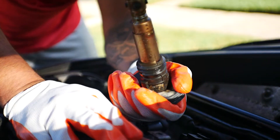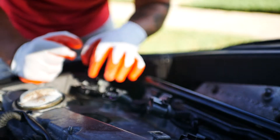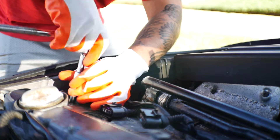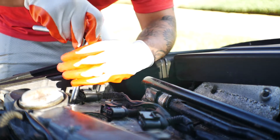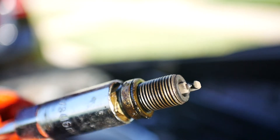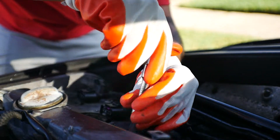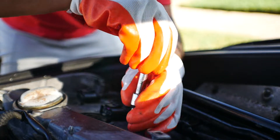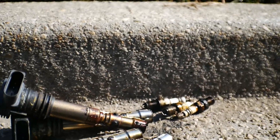This one looks a little dirty too and very grimy. Got to get the spark plugs out, so I'm gonna grab my spark plug socket and start screwing these off. This should be a 15 millimeter spark plug socket - and that is actually very loose, that's not a good thing. That looks disgusting. I think all of them are going to be in this same sort of condition, so definitely need a tune-up. These things are so loose that I can literally unscrew them by hand - that is not a good sign. Whoever had these running definitely left them all loose. These coils look terrible - full of oil. That valve cover gasket definitely needs to go.